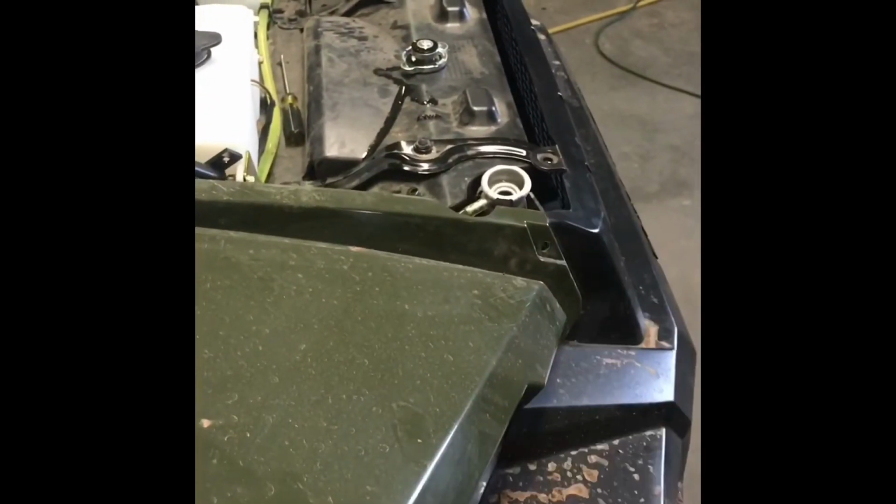And as you're filling, you're going to get air and fluid. You're getting fluid right now, but there's a lot of air still trapped in there. So I'm just gonna start filling up until all the air bubbles come out. And we'll do this process several times throughout. But for right now, that's all on, heater's on hot, and start filling this. Okay, I have filled up, topped off the radiator. Now I have got solid fluid coming here, so I shut that off. And now we're going to start it, and then we're going to let it warm up a bit.